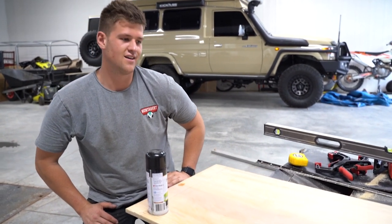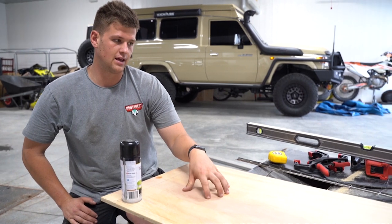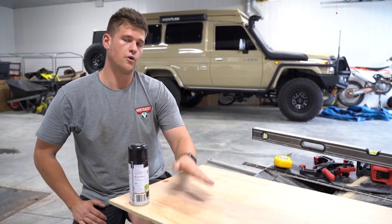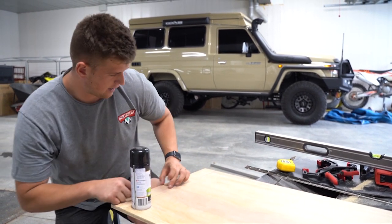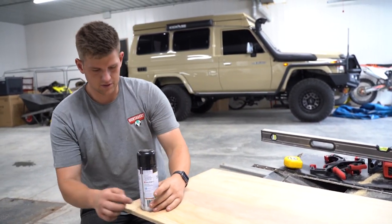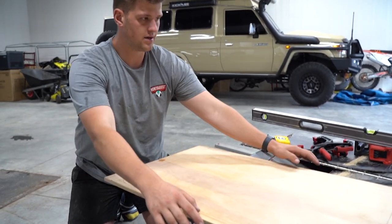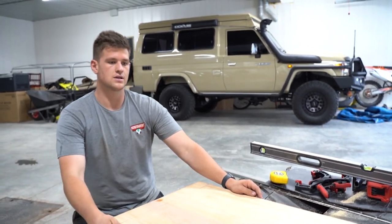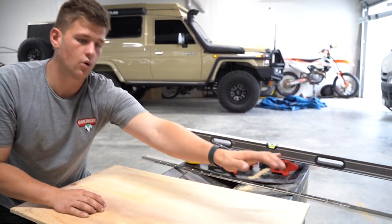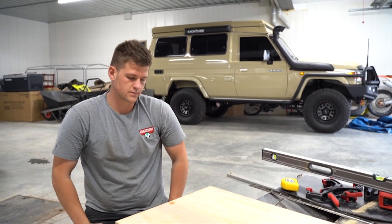So I come home from work again - second belly back, it's a bit of a killer - but working on the troopy again. We are making the bench seat that will fold up for our storage behind the seats. There will be an outer edge of the bench that stays down and then the middle will pop up. I'm making all the corners nice and curved, and that 10mm section will sit on the aluminium for support, so the outer edge will stay when you lift it up. This will also miss the window and the pantry door when you open it, because the troopy obviously starts curving in at the window. Should look pretty nice.